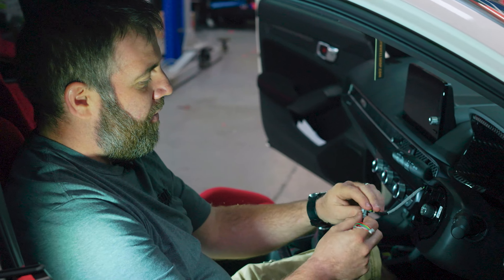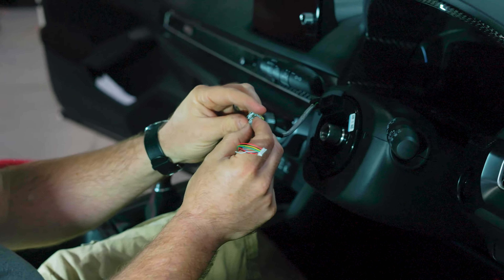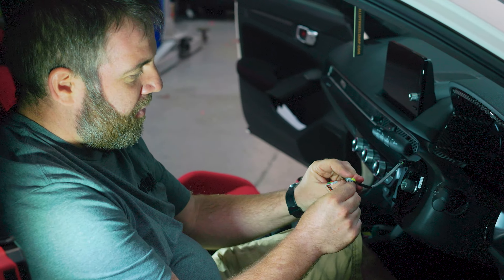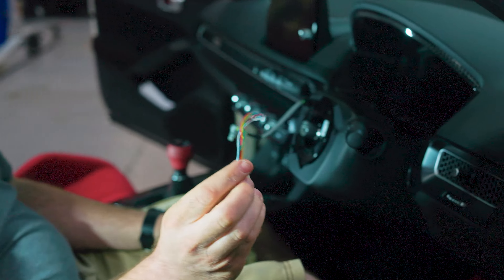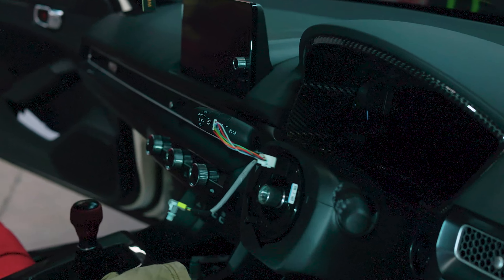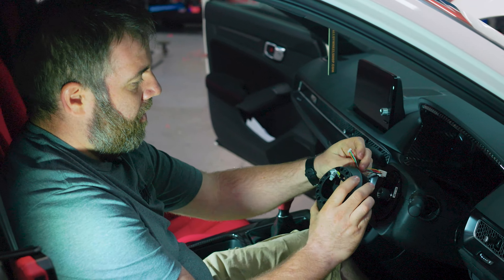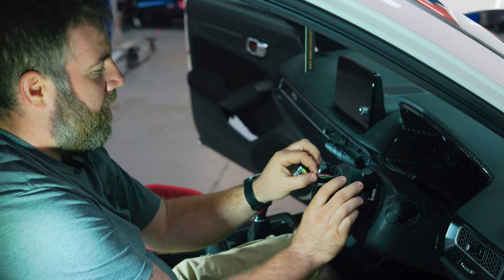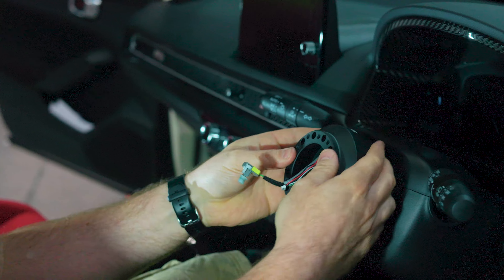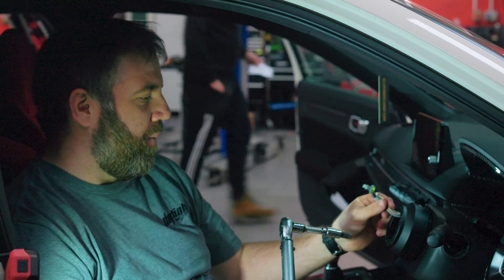Now that the original wheel's off, we can fit the airbag blocker that came with the Zest Tech kit — a nice little resistor that just pops into that connector. It doesn't seem to have a right or wrong way around. We're also going to pop in this wire that also came with the kit and plug that in. Then we get the adapter and feed both of those wires through it, and pop it on, using one of the bolt holes at the top to line it up with the black mark I put on earlier.